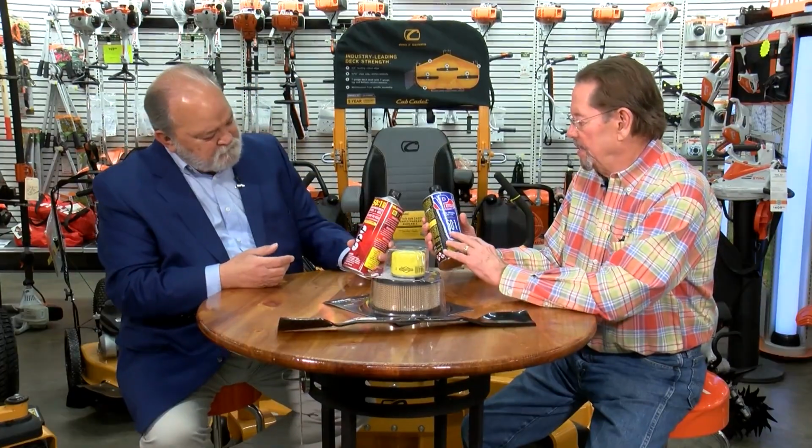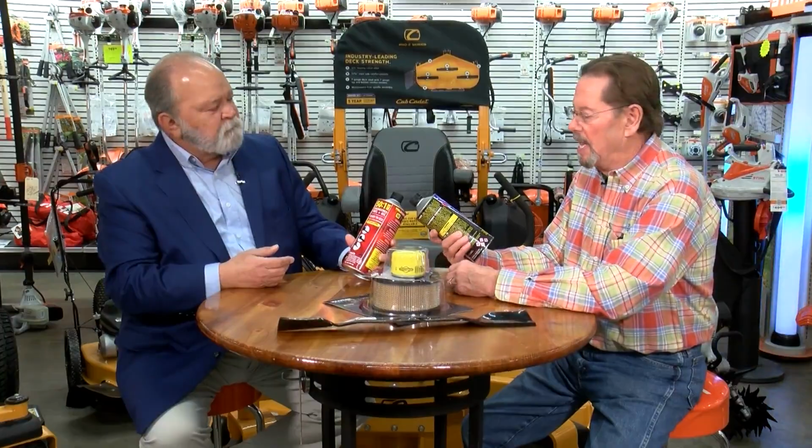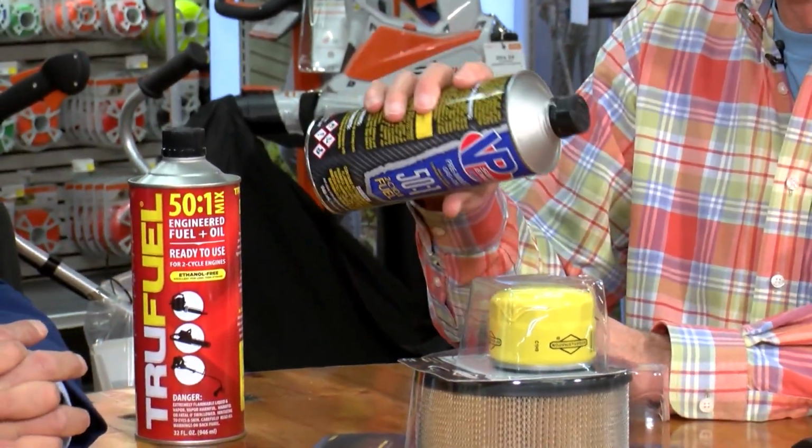Let's talk about something else, because there are mowers and weed eaters that have fuel mixtures, and you found a way to shortcut things here. It's a pretty pure mixture. Right, and there are two different brands. We sell gallons, 5 gallons, even 50 gallons. Some companies do it. Saves downtime. It's pure fuel, pre-mixed. All you do is pour it in. It may sound expensive when you start buying it, but with no service problems and no downtime, you'll find out it really doesn't pencil out too bad. We've got companies buying 50-gallon drums to cut their downtime. If your fuel mixture isn't right, you're going to start to gum up the works. Sooner or later, you're going to have to bring it in for servicing. This can help you alleviate a lot of that. And in winter, it's easier storage because it's pure fuel. Just run the carburetor dry, you don't have to service the fuel in any way, and you'll be ready to go.